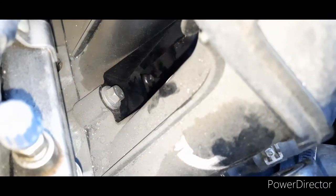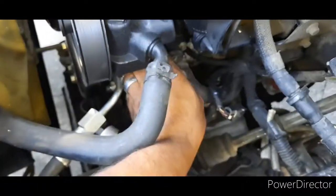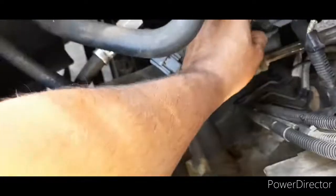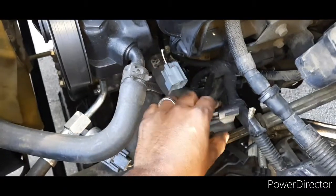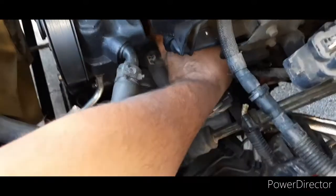You can see the tail and the plug that it plugs into, you just can't see the knock sensor itself. So it's going to go by feel if you don't want to take off the whole intake. But it can be done — it's just a little tight.